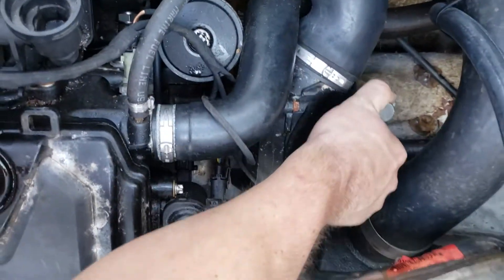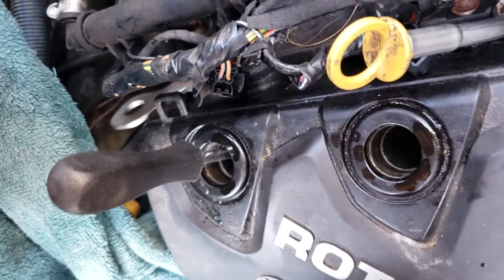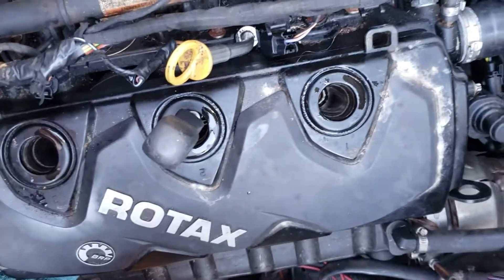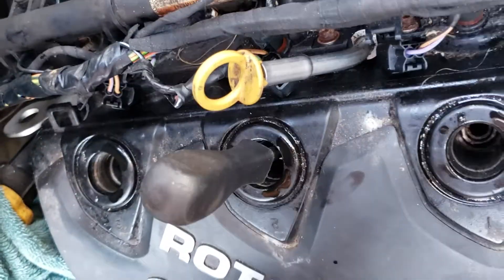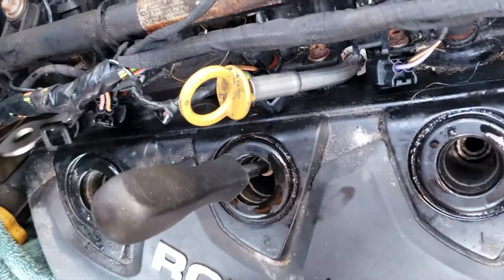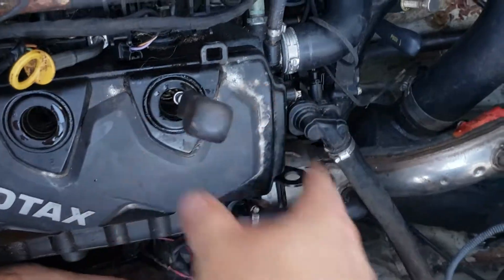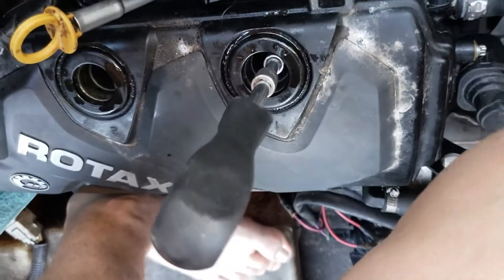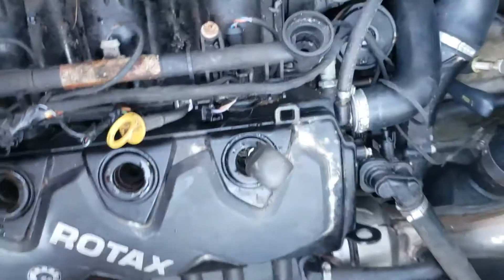Mine isn't seized — you can see it moves up and down. If one moves, they all should, unless you've got a connecting rod that's totally busted. It's moving again — up and down. This next one barely moves because it's right at the top, but it is moving. That's a quick way to see if it's seized or not.